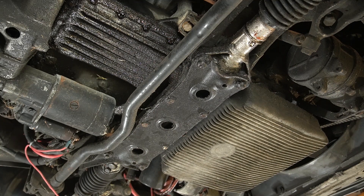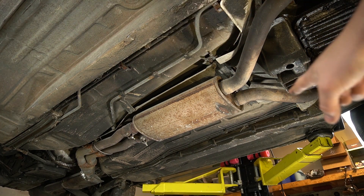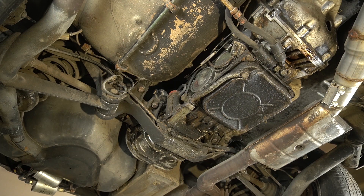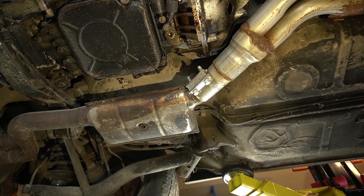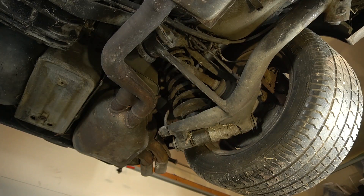It doesn't even seem to leak that much, which is promising. In the middle we have our European-specific exhaust — this is all different from mine, which had a ginormous catalytic converter in the middle. The frame rails are actually straight, though one side looks a little rougher. Moving toward the back, the transmission appears slightly different from my automatic — I don't see the same reservoir and the bell housing looks different, so it might be a 3-speed as opposed to my 4-speed. There's also a fillable reservoir, a big dent in the pan which is a little concerning, some different linkage, and a band clamp with extra welds — I assume the exhaust has been pieced together.